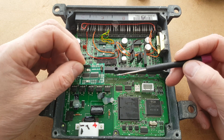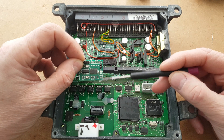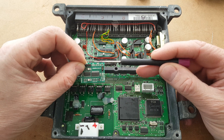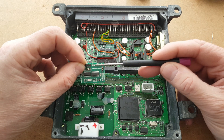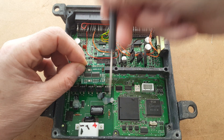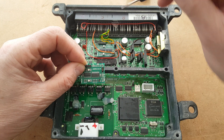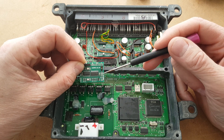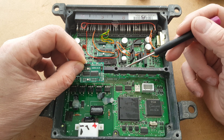There are a number of connections on here. There are four connections on this little strip and six connections on this little strip. Of the six, pins 1, 2, and 3 are inputs from the ECM which is at the front of the car — those are the pins coming into the controller — and the other three are outputs going down into the circuit board. The four-pin strip carries the power, command inputs, and the SCS line control.